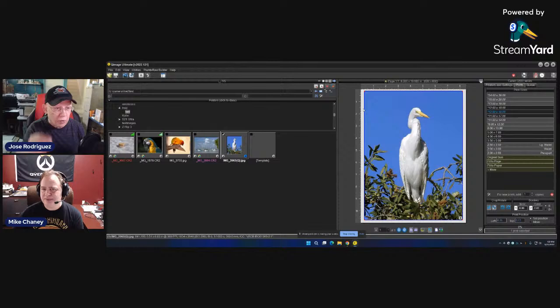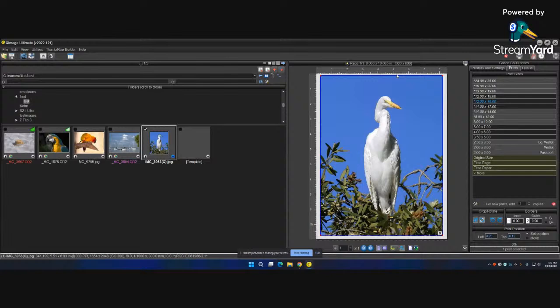Why is it not the same? These are hard margins. These are dictated by the printer. So you cannot print anything with any software in there. And I've always assumed, I thought you probably would have a better idea than me, but I've always assumed that on the leading edge of the paper here, you don't need as much of a gap, because when you get down to the trailing edge, your rollers may not be able to push that paper.